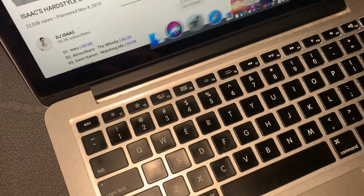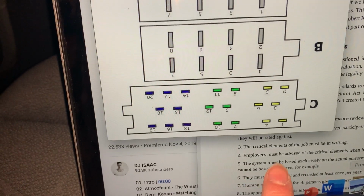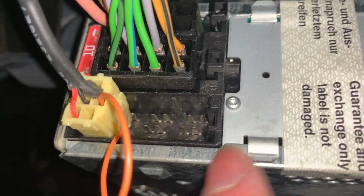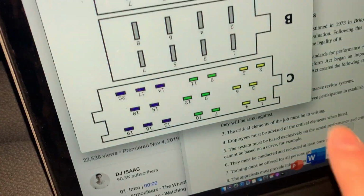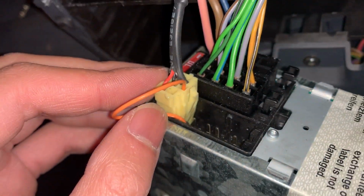and this is the pin information here. So we're shorting out this pin 13 and pin 15, and this is the orientation of the plug here. You got the flat, the smaller edge here, just like how it is on the diagram here. So yeah, you just have to shave down this, but maybe if you buy the right connector, you won't have to shave it down.